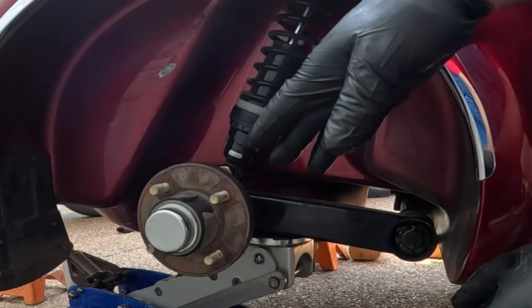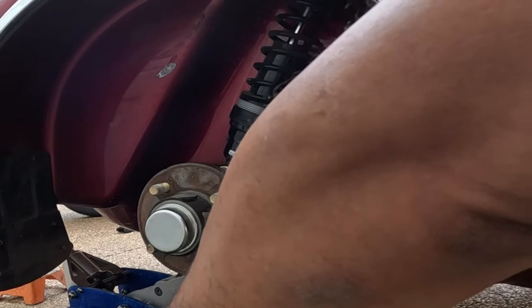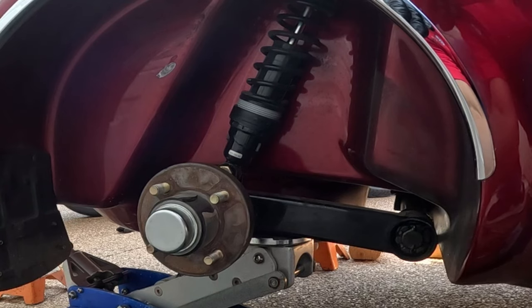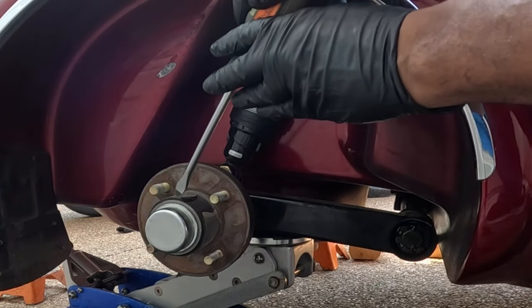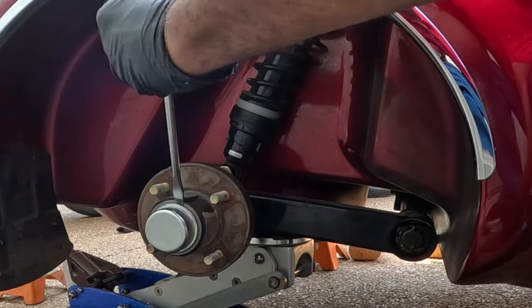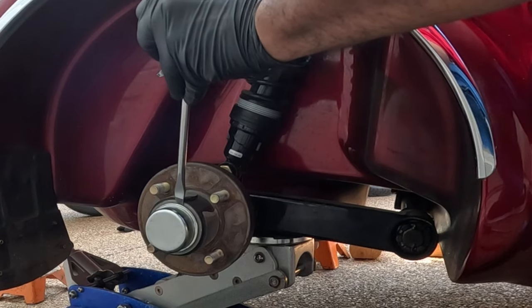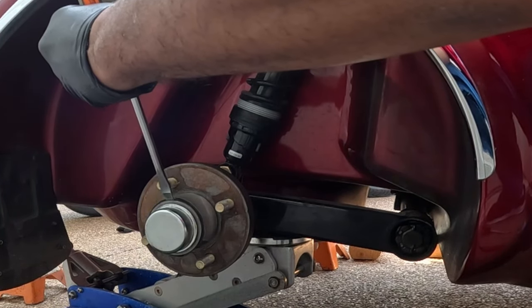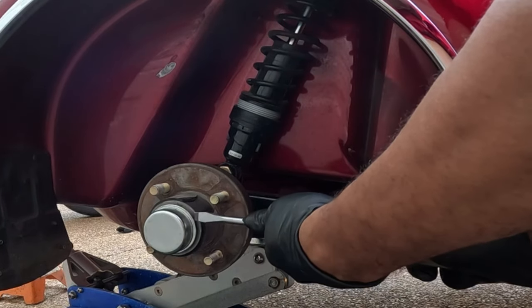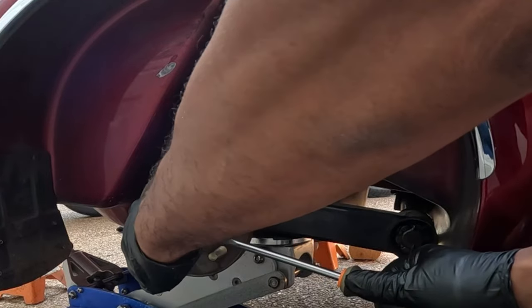And so that's the thing about doing wheel bearings, is that it's a greasy job. No one likes to grease bearings, but if you don't grease your bearings, I promise you, on a long distance trip, you are subject to have a breakdown. I'm going to rotate that hub around. Unless your bearings are sealed, you need to grease them.